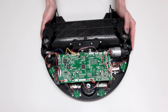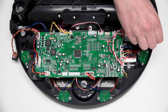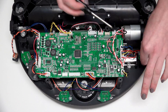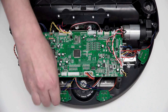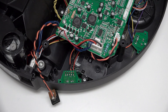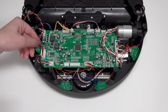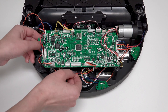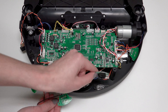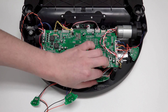There are 4 edge sensors on Bob's underside along his front. There are 2 screws holding each sensor in place. Remove all 8 screws and save them for later reassembly. Feed the wiring for the 2 outermost sensors out from under the mainboard toward Bob's front wheel. Do not remove the plastic sensor covers from inside Bob. If a cover moves out of place, simply place it back in the appropriate spot.